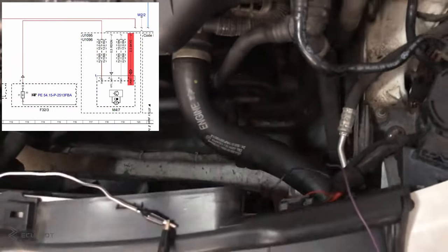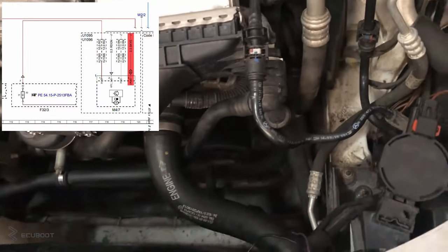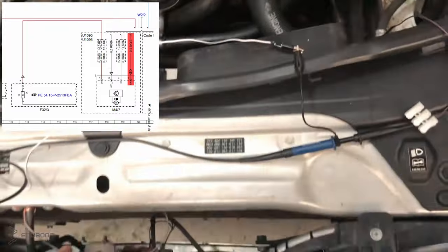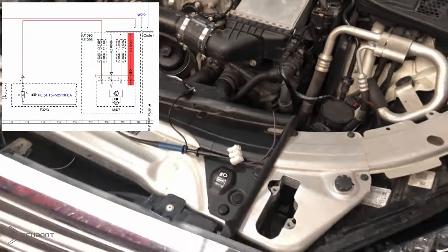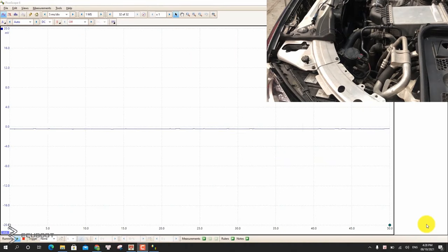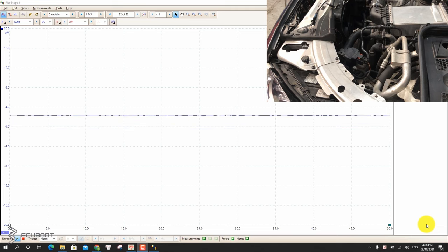I've already probed the wire to receive the signal that our N127 sends to the radiator fan. To measure the LIN signal, we have to turn on our ignition. As you can see, there is no signal on the oscilloscope but the fan is still running at full speed. This should mean that the signal isn't being sent from the PCU, so this might be the result of either our components or the N127 having a short circuit.